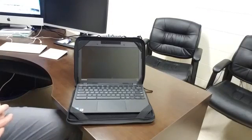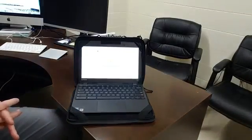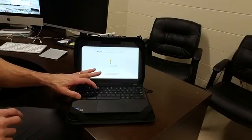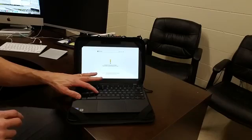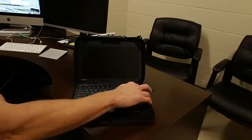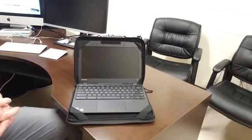This is going to restart your Chromebook — it will take approximately five seconds and come up to a white screen with a yellow exclamation mark in the middle. Once it's at that screen, press the Ctrl and D keys at the same time, then press the Enter key, and it's going to restart for a second time.